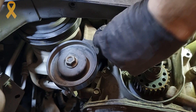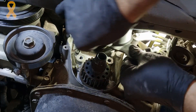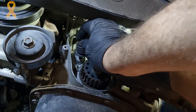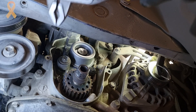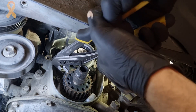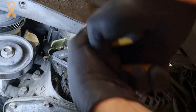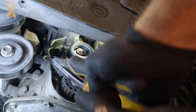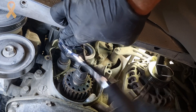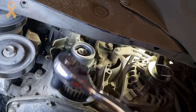Now we will remove the tensioner and its spring completely. Pay attention that the spring is under pressure and be cautious while removing it. We will assemble the new tensioner in reverse order — put it in full tension, meaning all the way to the right, and with the help of pliers we will lift the spring to its anchor point. Then bring the tensioner to the most loosened position and tighten back the bolts, but not all the way in.